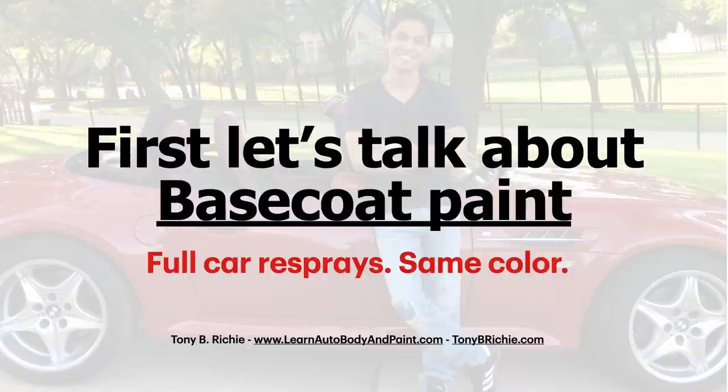Okay, if we're doing something custom, it's going to be a little different because you're going to need an extra layer of paint in between, right? Extra layer of base coat in between your initial base coat and your clear coat.